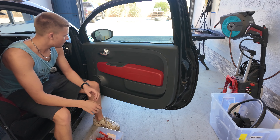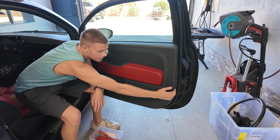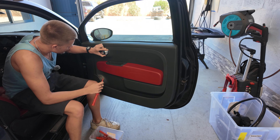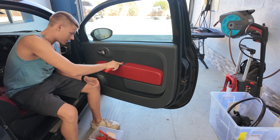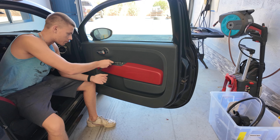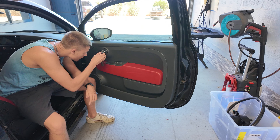Right, so the door card is now going to come off the car. It's a matter of taking off this surrounding trim on the door handle and this little insert here - we need to pop that out. On some models, I think the American models, they've got an allen key through here with a little popper, so check your door. So we've removed the trim - that reveals the allen keys behind here and we're working with size 5mm allen keys.